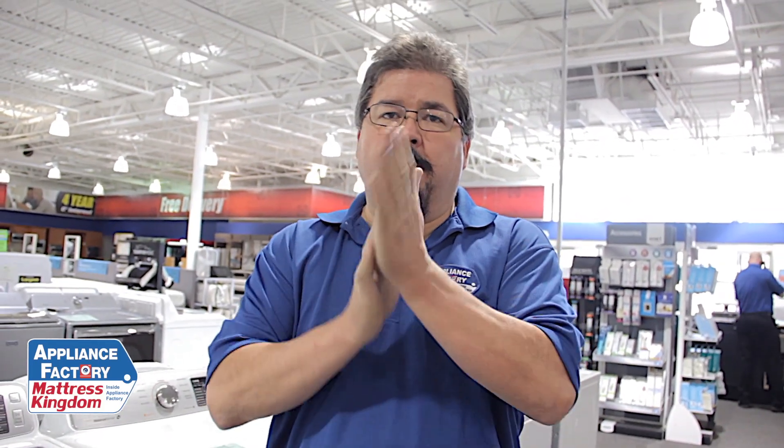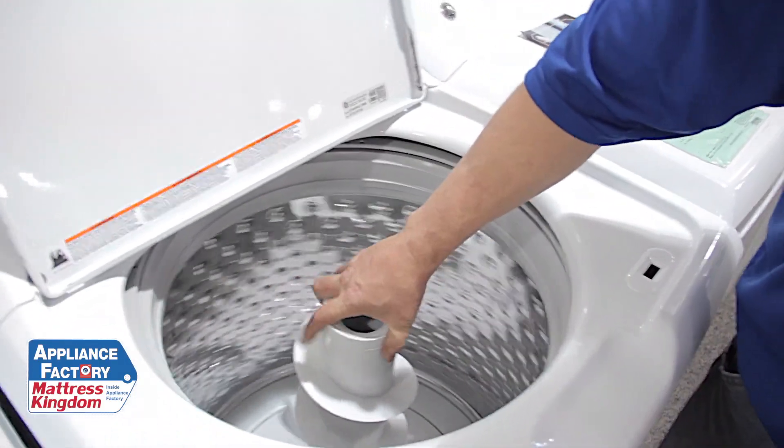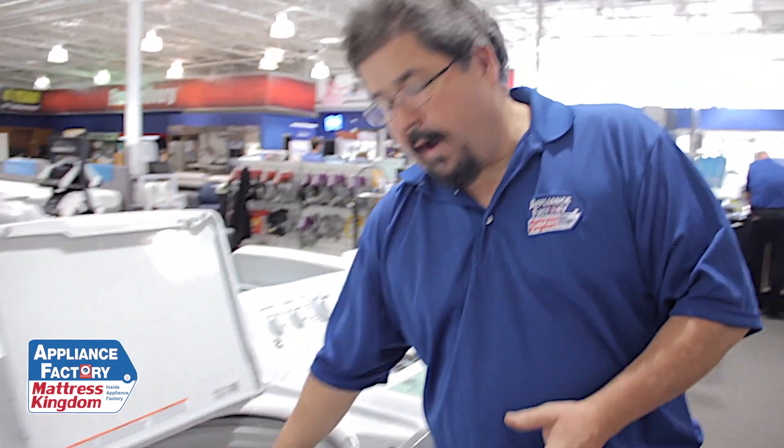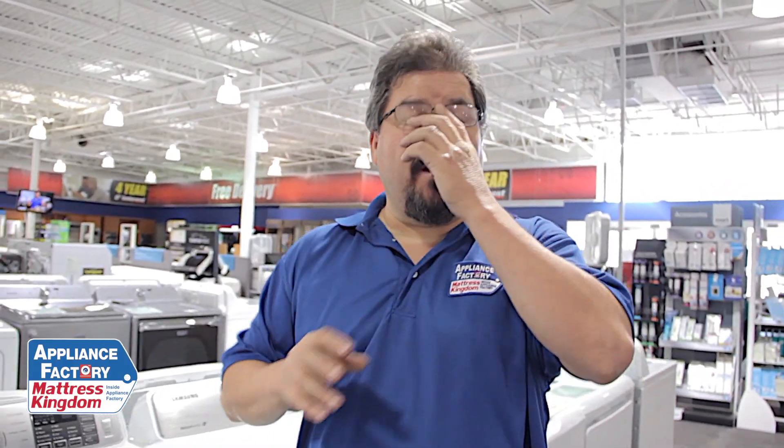But it's never going to float your clothes like the full fills will. The clothes will be a lot closer together, and the reason the clothes are closer together is when they agitate, the clothes themselves actually rub up against each other doing the cleaning. Whereas in your full fill, they have an agitator — the clothes will actually float with water between them and the agitator is what actually beats the clothes clean. So yes, you're not getting as much water in this, and the clothes themselves are rubbing against each other, which is a much more delicate way of cleaning. It doesn't abuse your clothes and basically allows your clothes to last longer.